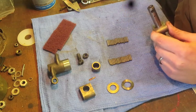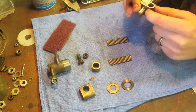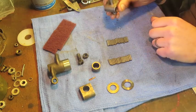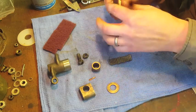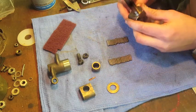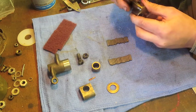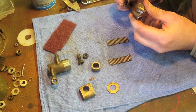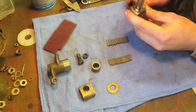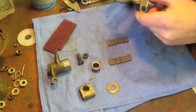This is going to be my left side intake. Our orientation is on the block: there's a raised ridge and on the other side a flat ridge. The raised ridge is what you want pointing out towards you with the hole pointing up, so gravity feeds oil down into there. A washer goes on first. If you're not installing these right away, use a good amount of grease to keep out moisture and prevent rust. If you know you're going to install them immediately, engine oil is probably the best lubricant since that's what will be running through the machine. In this case I'm going to use a little bit of grease but not a ton, since too much can clog passages.